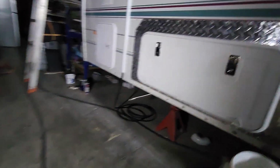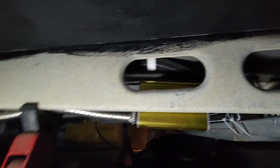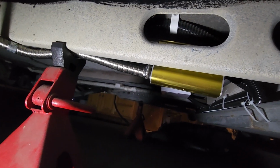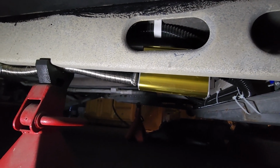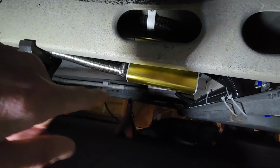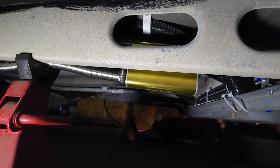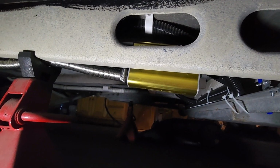as a final thing that I got for the diesel heater, one of these latest diesel heater mufflers, and they really do work well. It's actually working really well. They're made to silence your diesel heater, and they do. They are actually a proper muffler with an actual bend in them. I think there's a couple of bends in there actually, and then there's holes in it for the baffling, and there's actually a bit of fiberglass material on the inside of it packed around the baffles, so it works good.